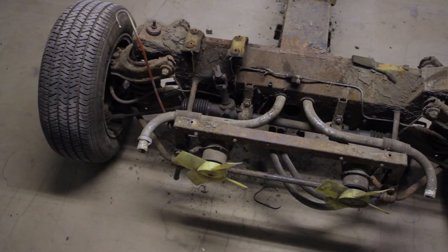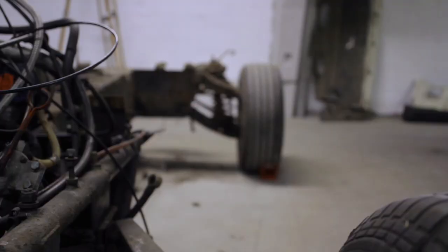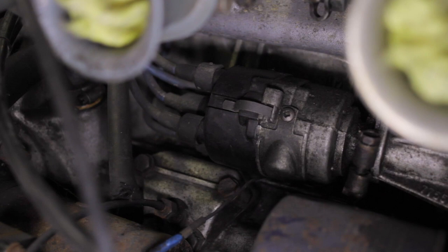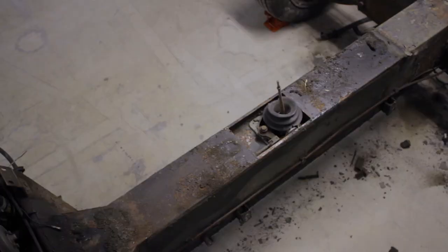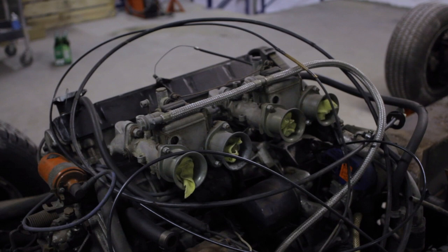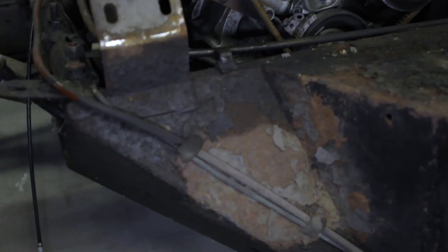I love this thing and couldn't care less what anybody thinks, because there's beautiful geometry in this chassis — and the little boy inside this man's body just sees a radio control car with the shell taken off. Up front you've got coolant tubes running through the chassis, wishbones, radiator, and fan setup. To the rear there are trailing arms, the Citroen-Maserati gearbox, and the distributor sitting pride of place below the carburetors — which is why, when these cars fell into the hands of people who didn't service them, leaking carbs would rain neat fuel down onto the distributor, and that's how many Esprits met their end.